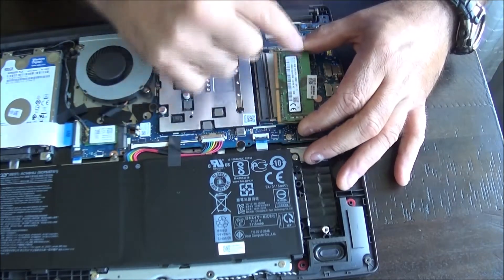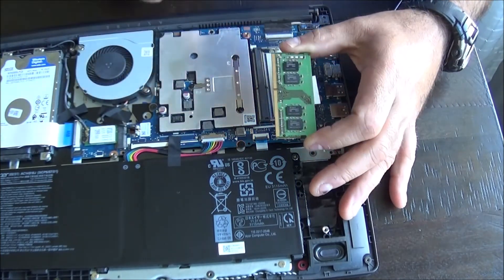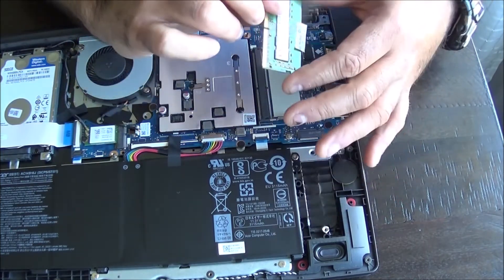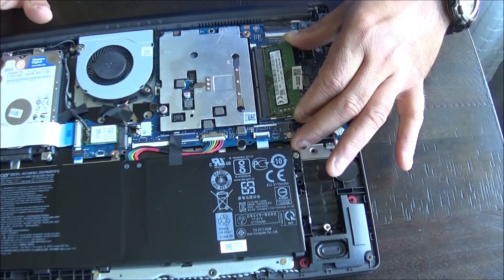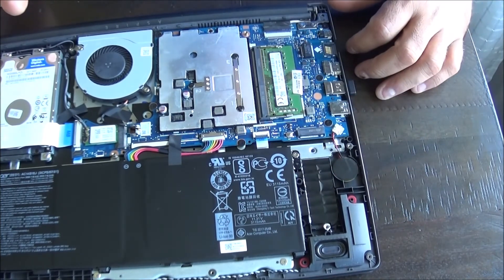The numbers are usually facing up. If you put it the other way you'll see the surface mount parts are visible, so typically it goes in this way. Put it in at an angle — actually less than 45, probably about 20 to 30 degrees like that. It's nice and secure — push it down until it locks and we're in.